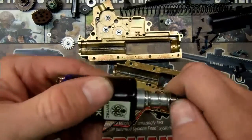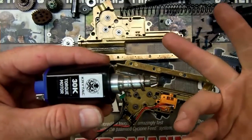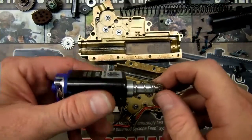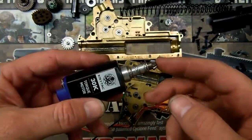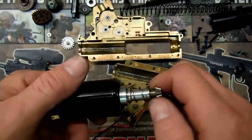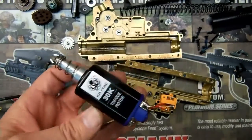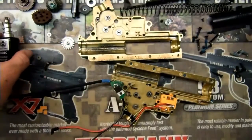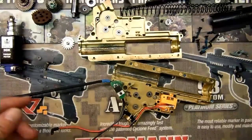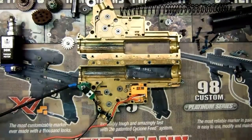The magnets are strong, but they're strong in relation to a ferrite magnet motor, comparably to like the SHS, the ZCIs, the JG Blues. These magnets are kind of weak comparatively. So I wouldn't pay $75 for this motor, wouldn't even consider it. I'll buy any of the other SHS, Lonex, ZCI, any of those instead.